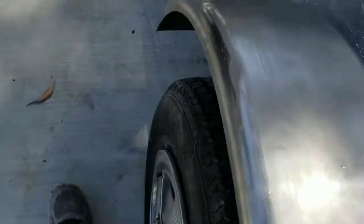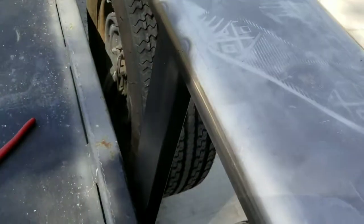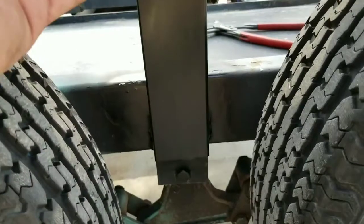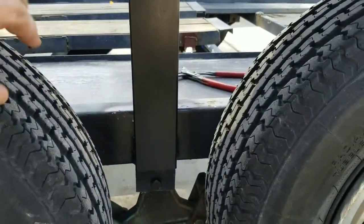Now you can just sit right down on the fender, stand up on it, whatever. So if it gets another blowout, there's a nice brace welded in here. It's out of the way of the tires. Got weld along here so that it has lateral strength, and some weld up here along the top. That just strengthens the whole thing up.